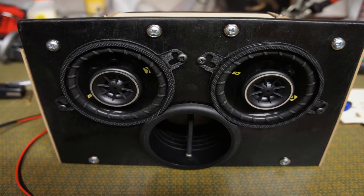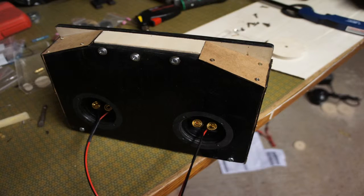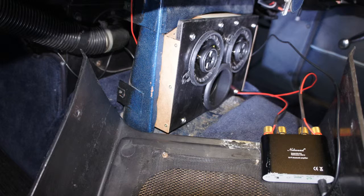In this picture you'll notice the back is painted and shows the two speaker wire connectors. I found I didn't have enough room at the back to mount them on the outside and screw them in from outside, so I mounted them on the inside and used small stubby screws from the inside out — installing them backwards from their intent. That gives me an extra couple of millimeters on the backside so I can push the whole unit into the speaker hole in the MG a little bit more.